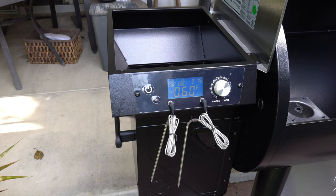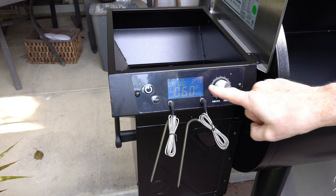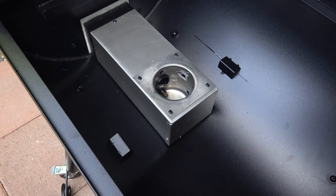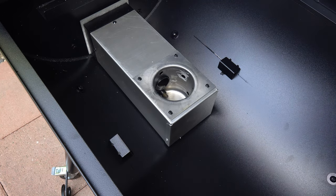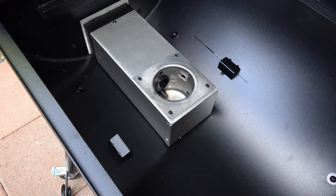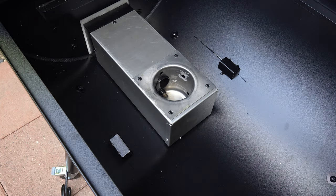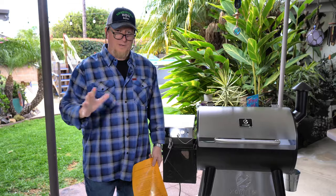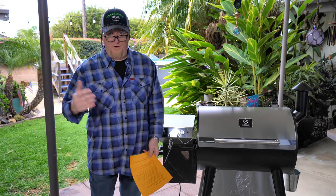Initiate startup by pressing the power button — the default grill temperature is 275 degrees. The display should show actual and preset temperatures; if a code appears, refer to your troubleshooting guide. Verify that the auger is turning after about two or three minutes on low setting, then feel for air blowing from the blower fan above the fire pot. The hot rod should start to heat up within three minutes — that's the first phase of this burn-in process.